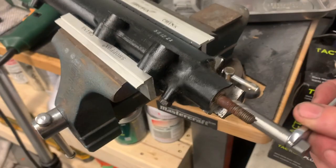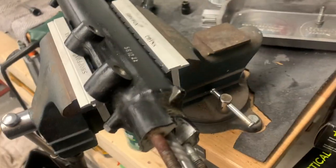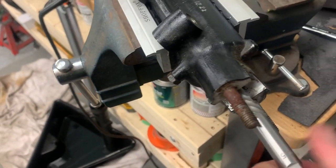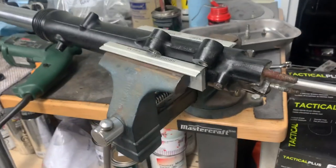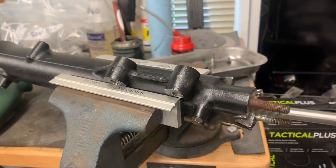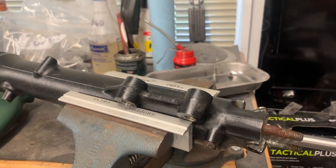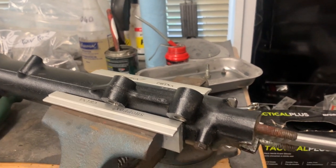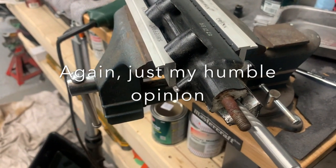After drilling and heating the snot out of it with my propane torch, it is finally coming out. There is never, ever a good reason for cranking those bottom damper bolts in that tight. Hand tight with a new crush washer is all you need — you don't need gobs of Loctite and an impact gun to put those things back on. Completely unnecessary, so please don't do that.